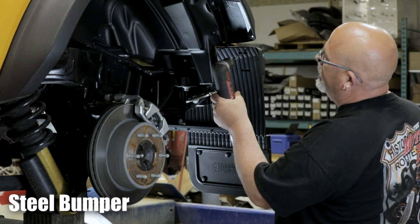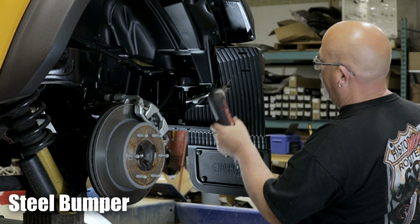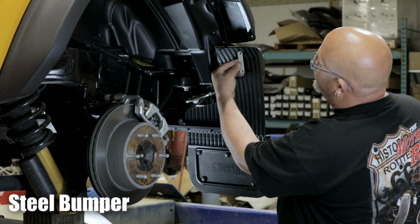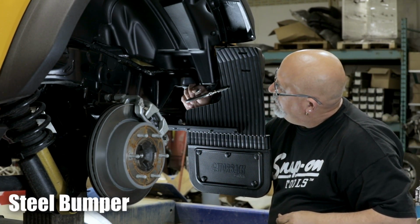Please note that the Bronco we had in this video was on tour at the time of filming, and we were unable to drill into the bumper because of this. With those 2 holes drilled, we can secure the flap to the bumper. Position a washer nut plate into the interior of the bumper, placing the plate behind the 2 holes you just drilled.